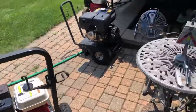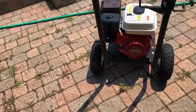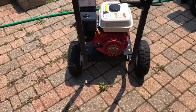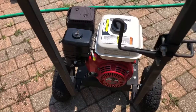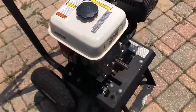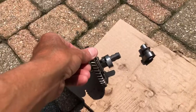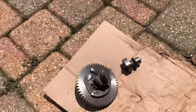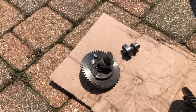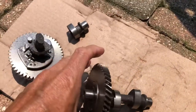What am I working on today? This is the project right now. This is a North Star branded six-and-a-half horsepower pressure washer with a true Honda Japan-built engine - the good ones. I've got the pump off of it right now because the previous owner did not realize that if the cam is taken out you better put it back in the right way. The Honda timing mark on the crankshaft is real tiny, and if there's any wear on that gear it's even harder to see. So I have a correct cam here.